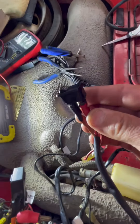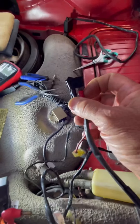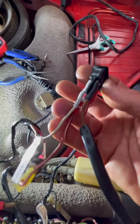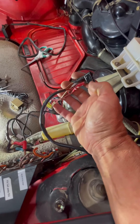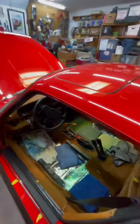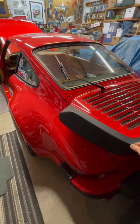I hope that explanation is helpful. This tiny little switch is very important in operating the rear wiper. It has smaller than typical blade connectors and small harnesses. I'll need to put the switch in the dash first, noting the positions of the wires on my particular car, then reconnect the switch on that side of the dash — it just presses into its spot. I hope that's helpful to you, and I hope you are successful in making your rear wiper work well. Good luck.